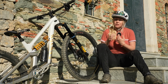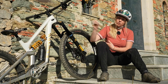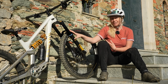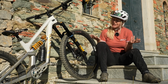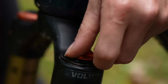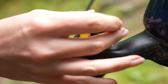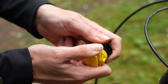Equally, if you're a light rider like myself and you find they're getting too firm towards the bottom of the stroke and maybe you're not using all of your travel, then do open up your forks and check to see if there's any volume spacers in there, because if there are, then maybe you want less. But do head over to my other video which shows you how to change volume spacers, because you will need some safety tips. You'll need to be removing air before you change those. So I'll leave the link of that video in the description below.